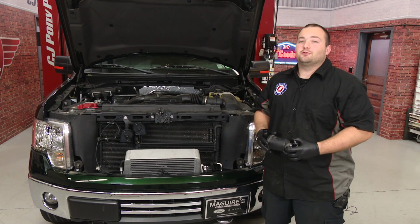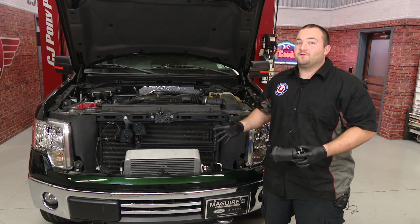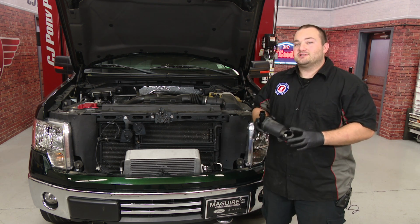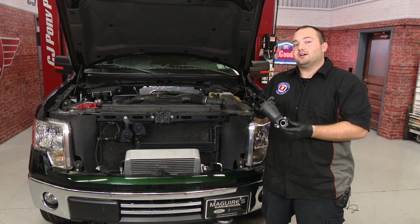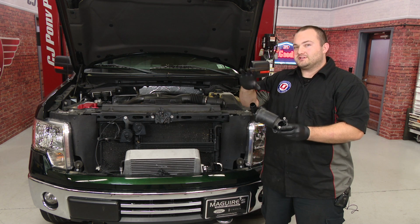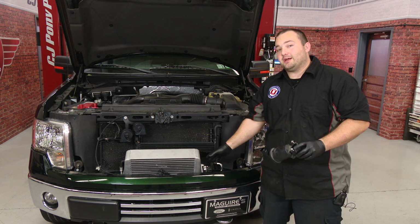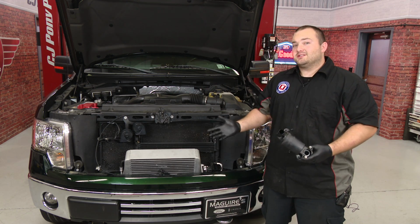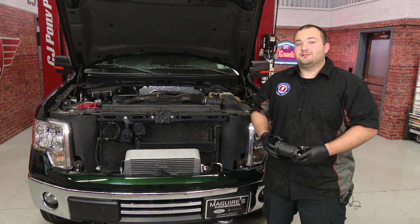The CPE Delta Core front mount intercooler is installed as expected. Fitment was really good, mounted up super easy, it looks great, but it is important to note that you do remove the stock blow-off valve muffler and recirculation assembly, and it does vent to atmosphere, so it is significantly louder than the factory blow-off valve. Installation should take about 2 to 3 hours, and before you know it, you'll be heading down the road.